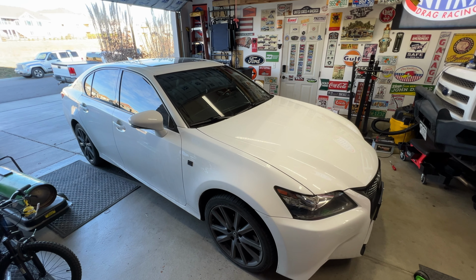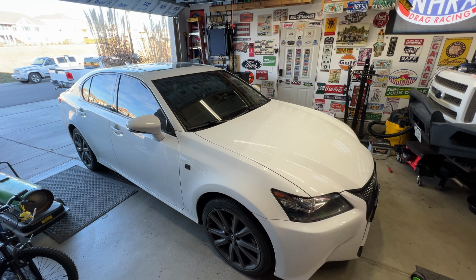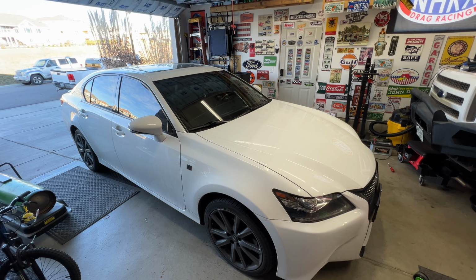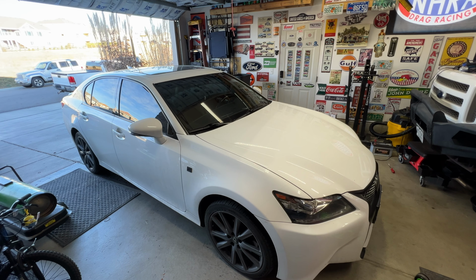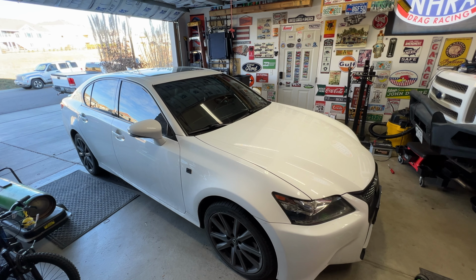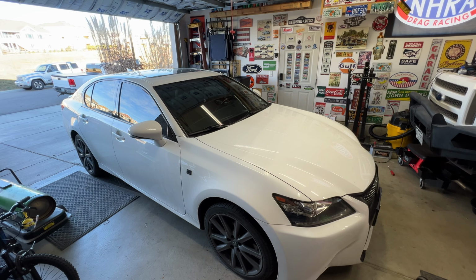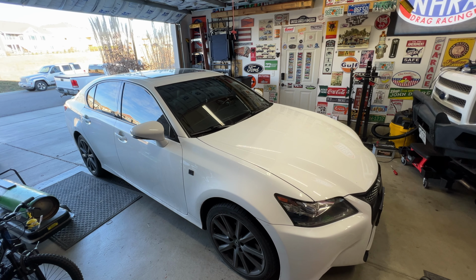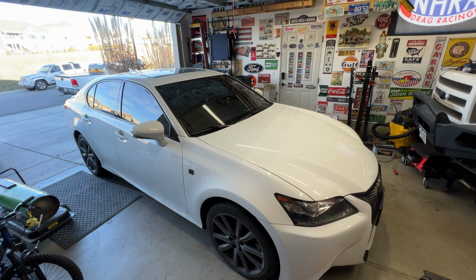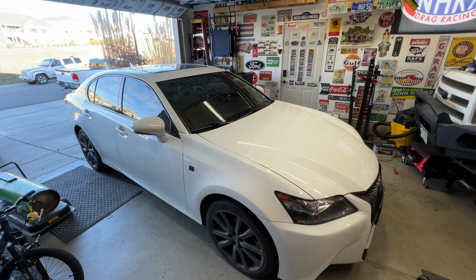All right, guys, so that's going to do it for the video. I'm going to go ahead and break in these new pads to the rotors. The way I'm going to do that is take this on a spin, get it up to about 35, 40 miles an hour, and then kind of slam on the brakes till I get down to about 5 miles an hour, let off, and then just kind of coast and let those cool for 30 seconds, and then repeat the same process. You'll want to do that for about maybe 5 times, and then they should be broken into the rotors.